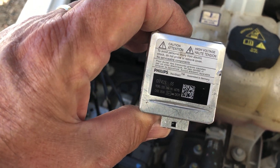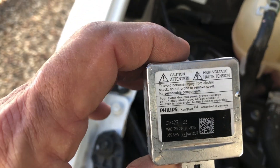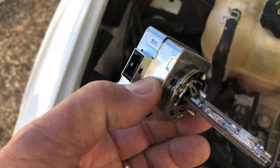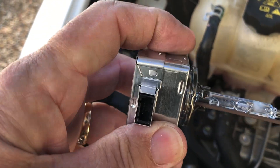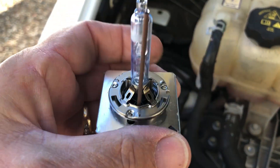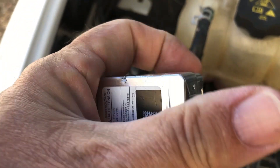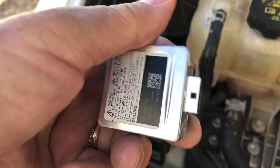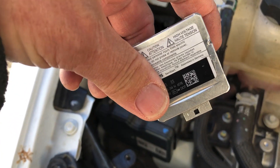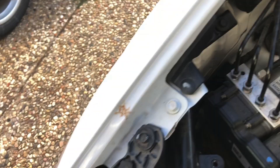I'm sorry I couldn't show a better view down in there, but the key is knowing what's going on — especially how to get the bulb out. Unlike other cars that have spring clips or a plastic intermediate device around the flange, this one you just untwist it a couple degrees, pull it out, take off the connector, put the new bulb partway in, reconnect the connector, push it in cocked a few degrees counterclockwise till you feel it drop into position, then tighten it up.